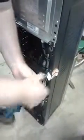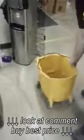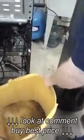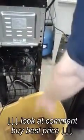This is the drain plug cover, and it's on all units. If you look, it's on 7 series and on KK's. It's all the same. So what you need to do is unscrew, remove that, then get yourself a pail or bucket, push it right up against the unit and remove. Water will then start to pour out.